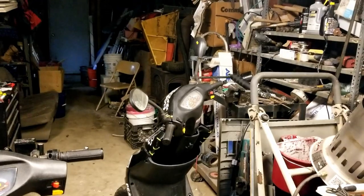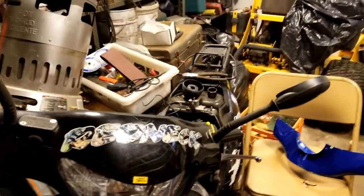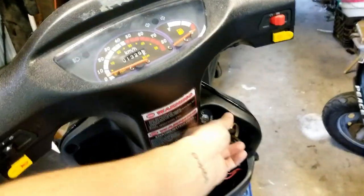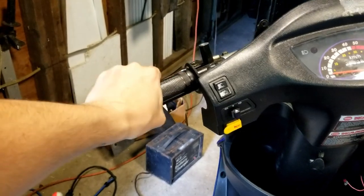I also can't get those stupid mirrors off, which I need to get the front cowl off — you can see they attach right here. This one's like busted. This whole bike is redneck, is what it is. Well, I'm an idiot — I'll show you what I got going on here. We'll start all the way: off, key, kill switch — I'm an idiot. Left brake. Spinning — not engaging. So the switch is figured out but it's not engaging; something's wrong with the starter. I need to pop the starter off and steal the one from the other bike.